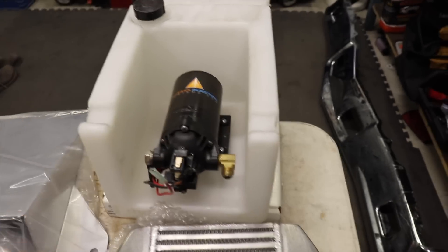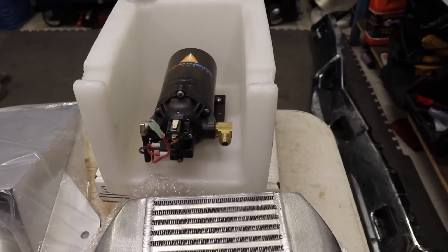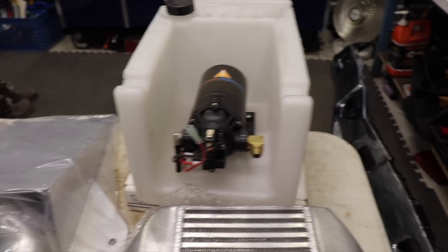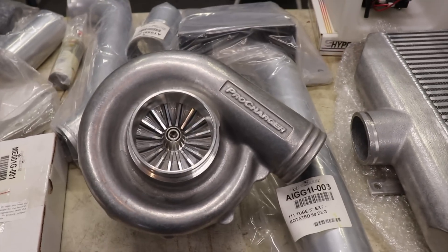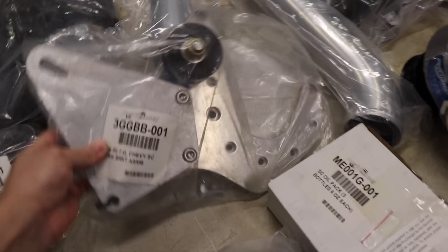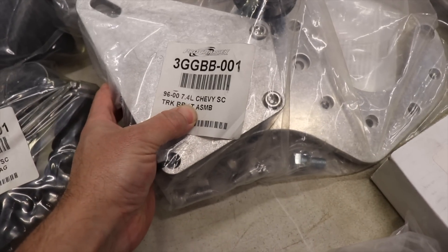I will be pumping methanol into my fuel stream to keep everything cold and boost the octane — it's awesome. I'll run that off a computer. I also want a three-step rev limiter: one for the top end, one for leaving the line like a two-step, and also a burnout rev limiter. Three steps — it's gonna be awesome. I've got all these pipes and everything to make it all work.